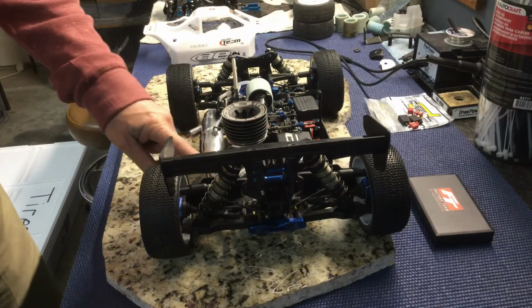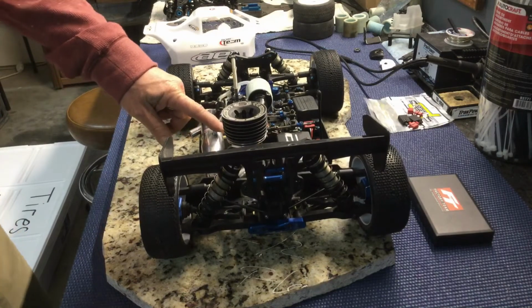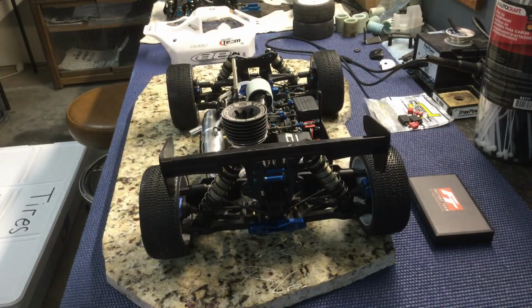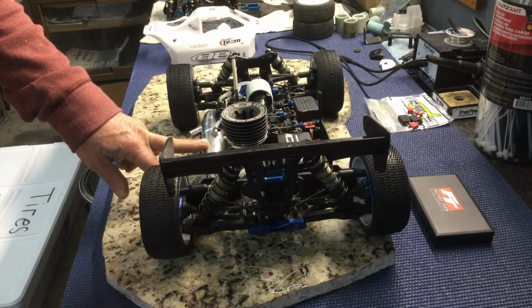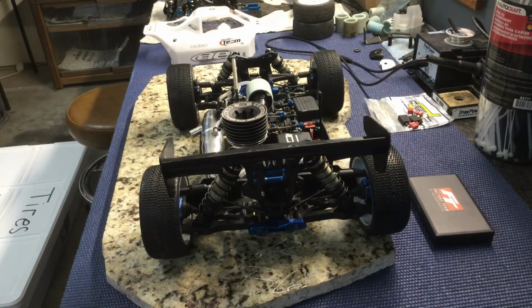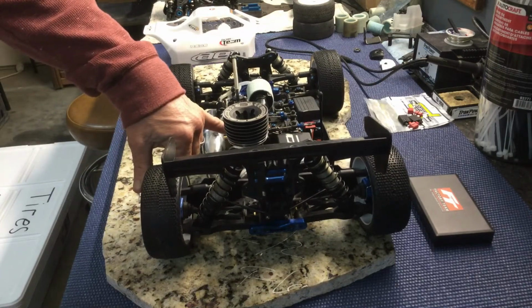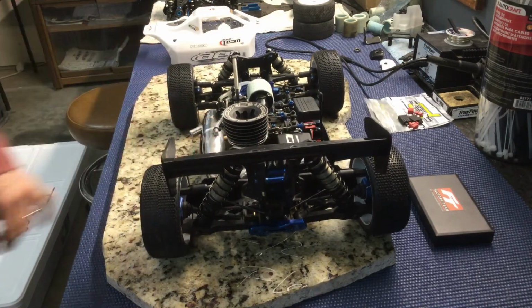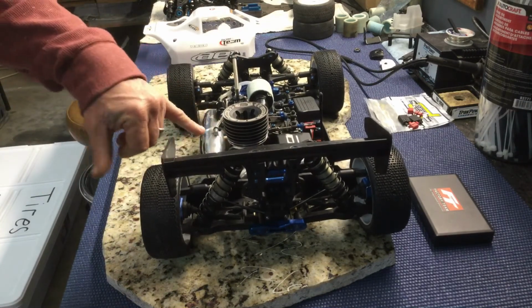Like I said, I ran the smooth pipe. The clutch is on the low engagement. So now I added the torque pipe. Last week, it helped it out a whole bunch. So I also started out with a regular stock 6mm Venturi, 6.5. So I changed the pipe last week.